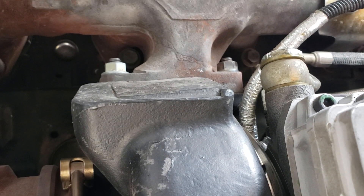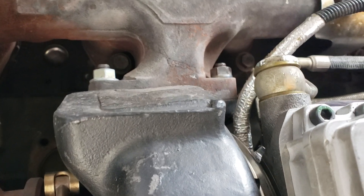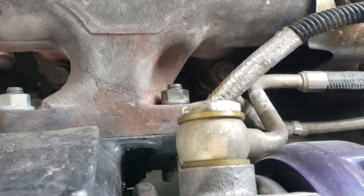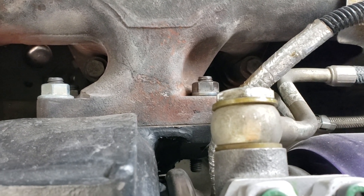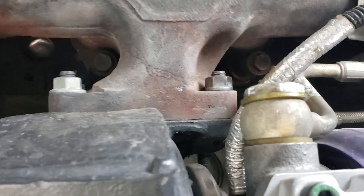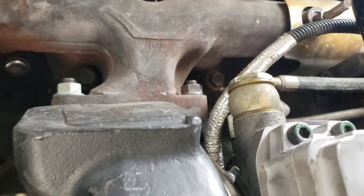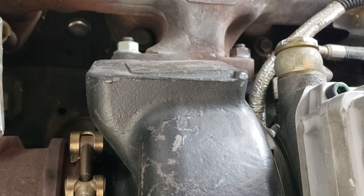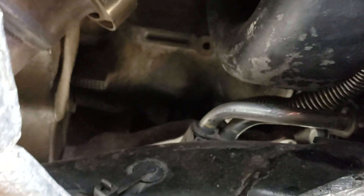When you're rolling in the turbo, there are three posts on the turbo and one post that's actually on the exhaust manifold. That fourth post is going to be behind the front one. I unscrewed that fourth post from the exhaust manifold and rolled in the other three — that seemed to be enough of a challenge. Then you're going to have to disconnect all your coolant lines and oil lines. The transmission line tip I read about on an online forum really was the cat's meow.